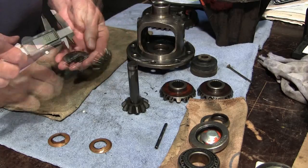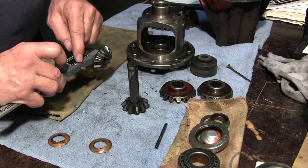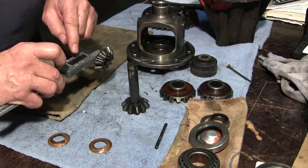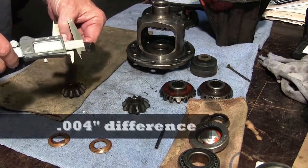The inside of the wheel: 0.6270 inches, 15.93 millimeters. That will be able to tell me the wear. I'm going to check the backlash on the sun wheels in the splines of the inner drive shaft — see what kind of slop I've got with the splines.